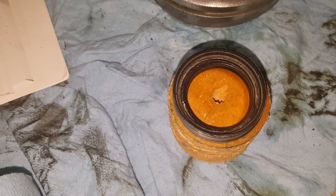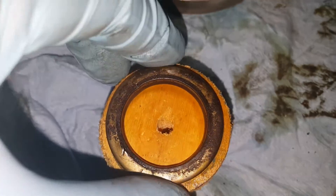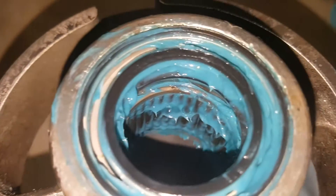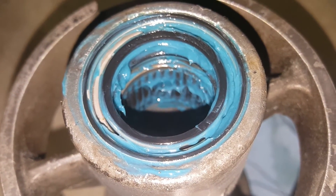This one goes that way — it's kind of odd. The reason I thought it was odd is because I thought anytime you have a seal it needs to go this way, facing down — but that's not really the case on this one. So just so you know: the first seal goes into the housing that way, then flip it around and the other one looks like this. You know you've got it right if you see the metal spring on the outside.